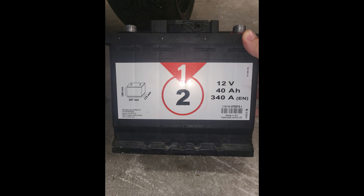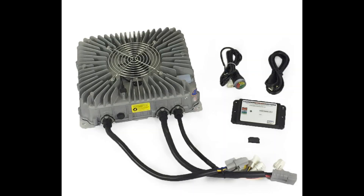Or rather, my setup of this battery that's causing the problems. This is the stock battery that came with this Bikmoto from Italy, original to this Piaggio Ape 50. This battery's got to be at least 30 years old, and it doesn't hold a charge. Because of this, the 12-volt battery is constantly draining down the 48-volt traction battery. After a month of letting the Bikmoto EV conversion sit idle, the 12-volt battery completely drained down the 48-volt pack. The way this Thunderstruck charger is designed, one has to unplug and then re-plug in the charger to start a new charging cycle — the charger won't just kick on because the voltage falls below some threshold.